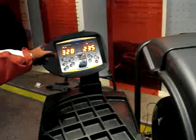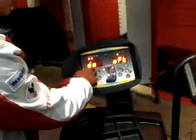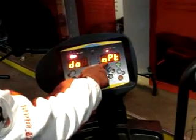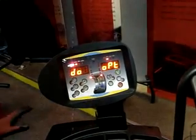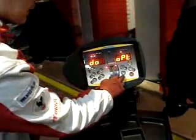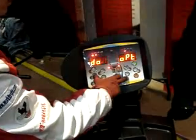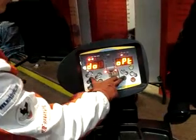And we see that is excessive large imbalance. And it shows an error 001 due OPT. So that means the machine now is not balancing. So it had an error. What we need to do to exit the error, we have to press F and number 2 button. This one. F, number 2 button.